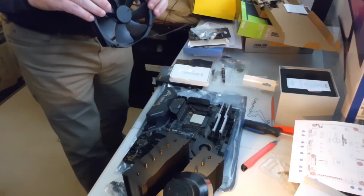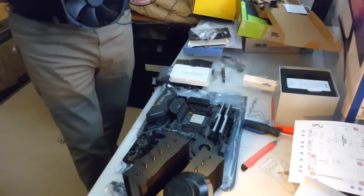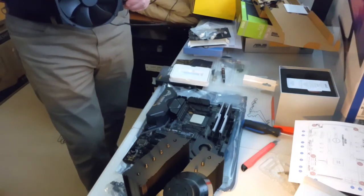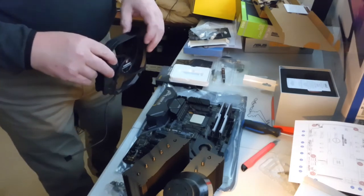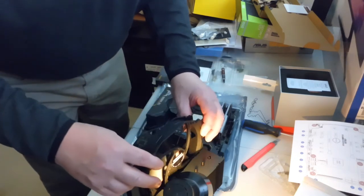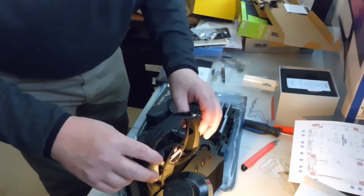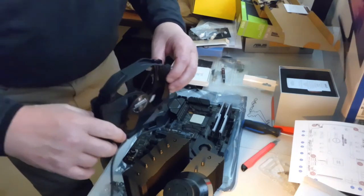Use the heat sink with the center fan only in order to guarantee best compatibility with tall RAM modules. Add the second fan to the front fin stack for further improved cooling performance. Connect the fans to the motherboard CPU fan headers. If necessary, use the supplied split cable to connect both fans to one fan header.